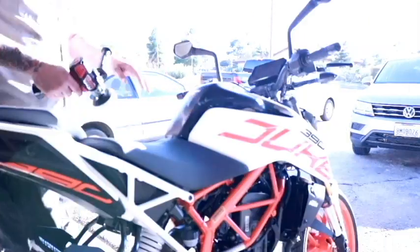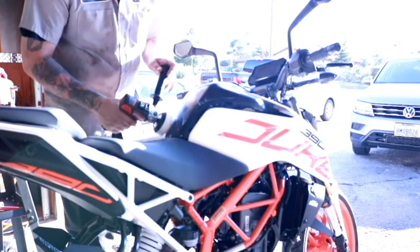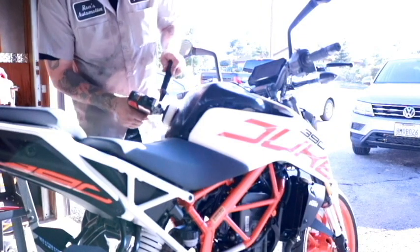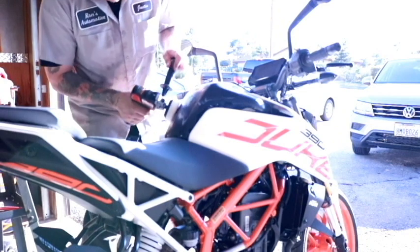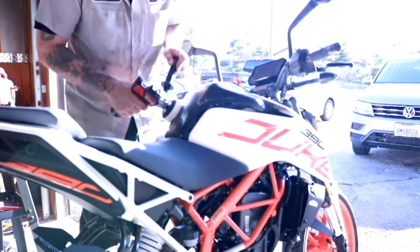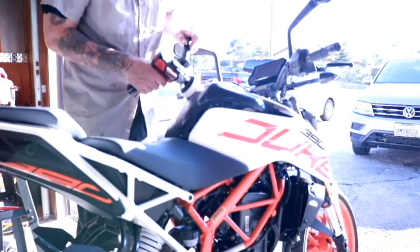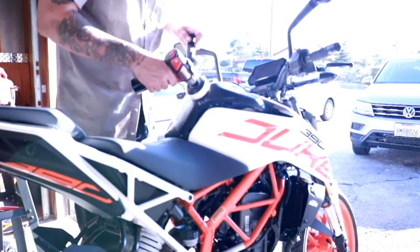There should be a couple of heavier scratches that we're going to try to see if we can't get out. Alright, so now we got our wax applied, a little bit to the pad, a little bit to the tank. I got my extra handle here for extra stability and support. And now, just as evenly as I possibly can, we're just going to go back and forth, really working that Carnauba into the tank.